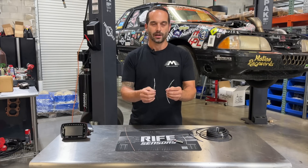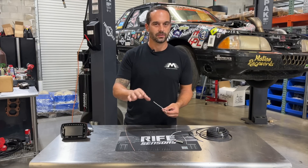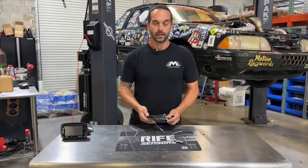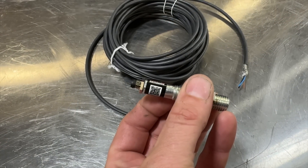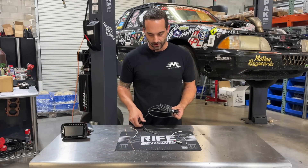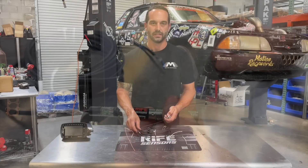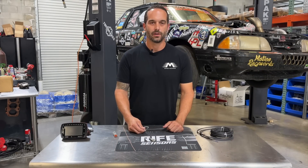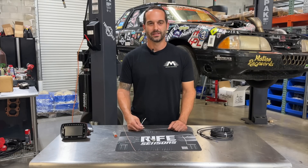It's not very difficult to do and not extremely expensive compared to normal wiring. The key takeaways: use shielded cables for speed sensors, ground the shielding to chassis ground — not to the ECU zero-volt sensor ground — and do it on the ECU side of the connector. This is why we sell our driveshaft speed sensor with an extended pre-terminated shielded cable — to take the legwork out of locating this yourself. All you have to do is ground the shielding wire, wire it to the ECU, and you'll have the best driveshaft signal possible. If you have any questions about shielded cable, put them in the comments or email us on the tech line. Thanks for tuning in — see you next time.